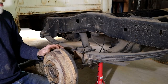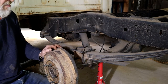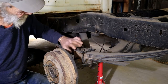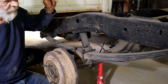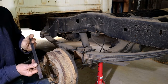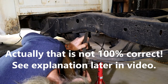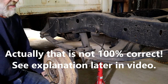So what can I do out here in the forest without access to any aftermarket parts to drop this back suspension? Currently, the axle is sitting below the spring. But if I put the axle on top of the spring, I'm going to drop the truck by quite a lot. How much will it be if I measure from the bottom of the axle to the top of the springs? I seem to get about 145 millimeters — that's close to six inches.